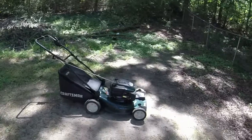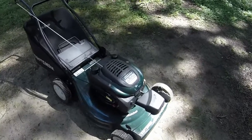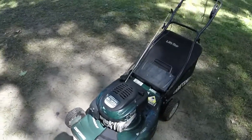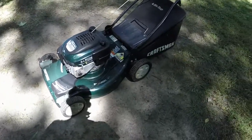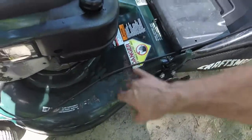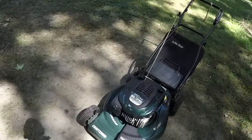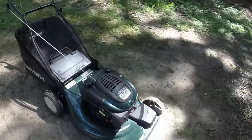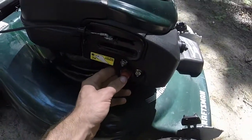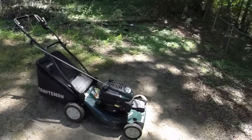This mower really did turn out nice — really happy with how it turned out. I'm a little bummed that I had to put a carb kit in it, but it gives me peace of mind selling it. I also put a new pull rope on it. Everything cleaned up really well — it's just got that little area of rust right there on the deck, but apart from that we're in great shape. I think I've got maybe $35 to $40 in this one and it should pull at least $100, probably $120. With the new primer bulb, it's not leaking any gas anymore, which is awesome.